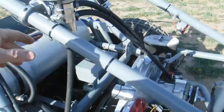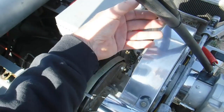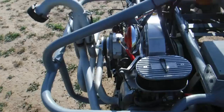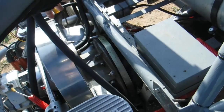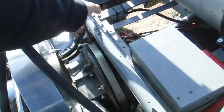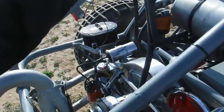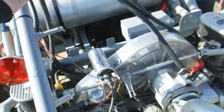This is off my old buggy. He had a breather box, and it was mounted right here to these two screws right above the fan, and it was a leaky son of a gun. If you've got a breather box — these engines do have blow-by, especially when they're oversized and at higher RPM — you've got to let that crankcase breathe. I know this kind of sits up above the frame. I understand why he did this, because even though it looks like you could put it any place, you need something to attach it to. I tried and tried. This has got a bar welded so I couldn't go clear around it. It's right in front of the fan, and if any drops of oil, it might get sucked right in there — so that wasn't a good thing. You want gravity to work with you so that it can flow back, and the blow-by can go up and out.